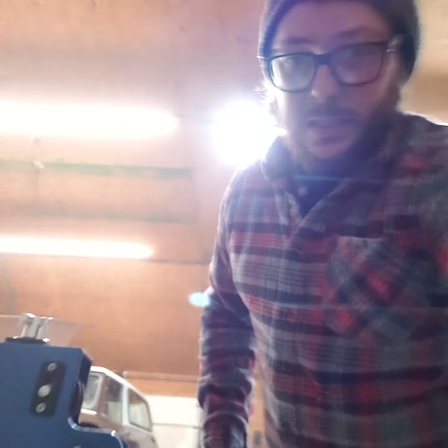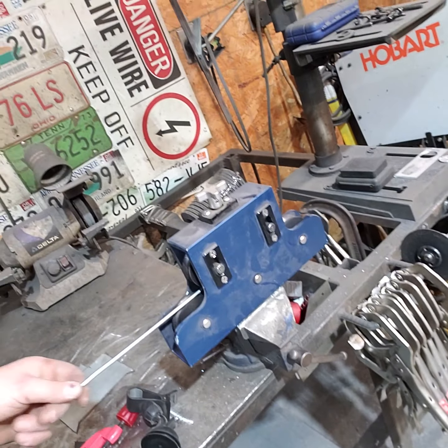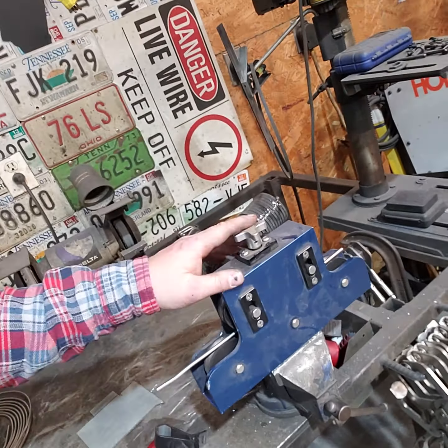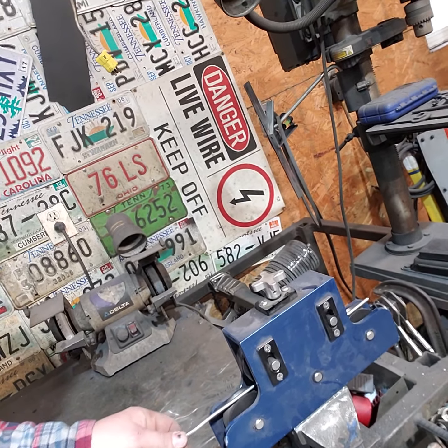Here's some of the tools I wanted to go over. The coils of brake lines are super cheap to buy in coils. So one of the tools that I have is this straightener. Basically how this thing works is you take a coil, insert it in this little guy, and you just crank the adjuster wheel down until it puts enough pressure on it that when you roll the line through, it takes the coil and straightens it out.